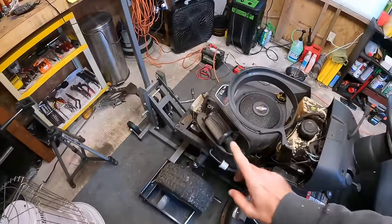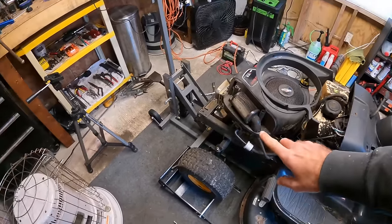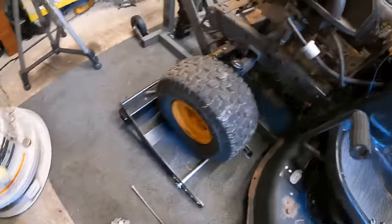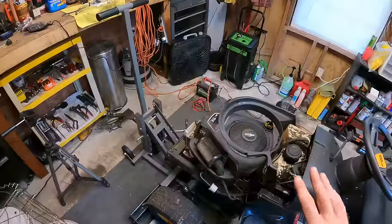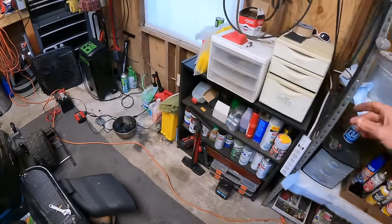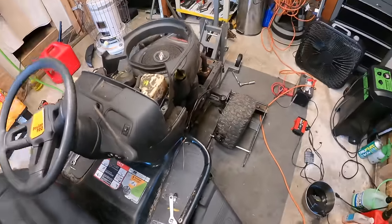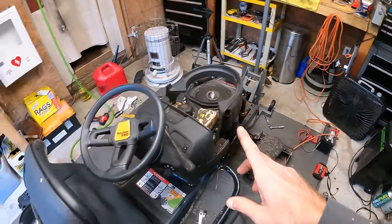For you guys that should have been about two seconds to put on that carburetor, but for me this is the third carburetor I'm putting on it now. This is another OEM Nikki carburetor — only difference is it has a straight fitting instead of a 90-degree fitting. I also noticed there was an NGK plug in here which is definitely not the right one for this single cylinder. It was also finger-tight. I got the correct plug in there, snugged up. Now let's give this a try with throttle brake set.